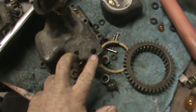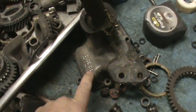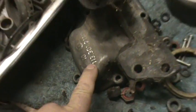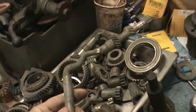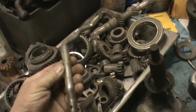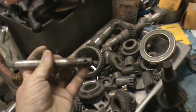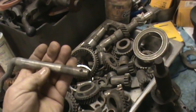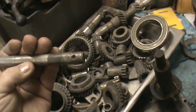On a car nose cone, the bolt holes will be offset; on a bus they're side by side. It'll be a 211 part number, not a 113 - 211 is a bus. Here's the hockey stick out of the nose cone. There are a couple of different shapes - the car is different from the bus. This one looks like somebody tried to make it work either way; it's got the detent screw on both sides for the grub screw.